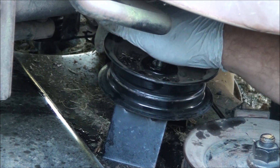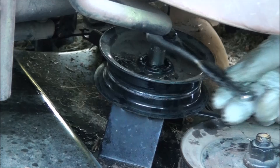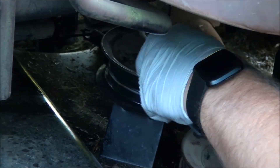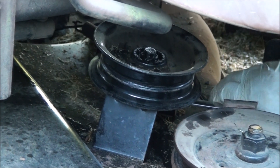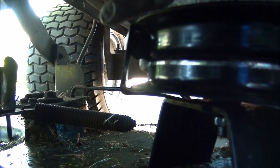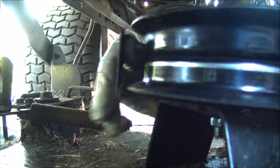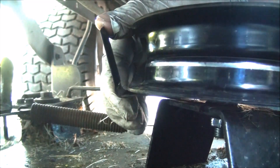Just make sure you don't knock that keeper out of place when you're putting this back together. We're getting tight now. See the way that thing is set there — it comes up a little bit above the pulley. It's grinding, so I'll have to bend it out just a hair. Just keep bending it out a little bit until it lightly clears.